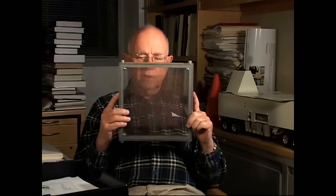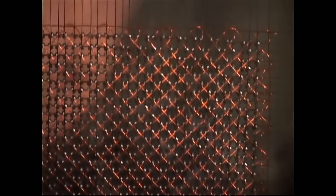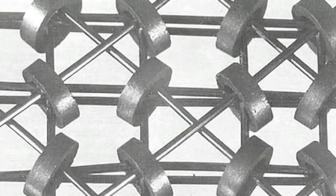This became very, very reliable. The storage is magnetic. Each of the little black toroids — they're like little tires on a car — Hilda wove all those wires through them. It's like weaving. The number of little cores on this plane, I believe, are 4,096. So this thing can store 4,096 bits. Today that's nothing, but then that was incredible. Each one of those little black toroids stored one bit.